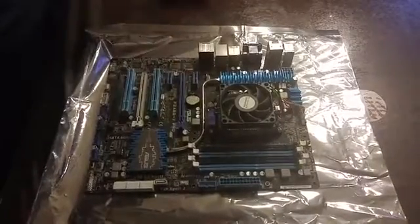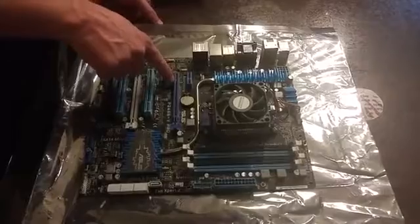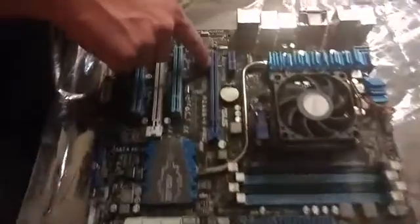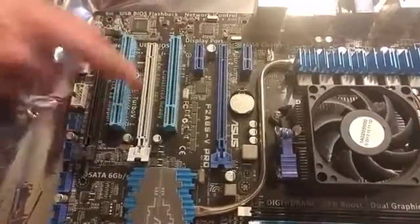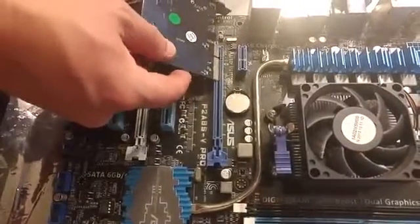Just so you can quickly look at the board and see which one is PCI Express — it's got the little part first, and then there's a little break right there, and then the long part. All the rest of them are a little bit longer with a short, or long with a short. So what you're looking for is the short-to-long. And it'll fit right on in there, just like that.